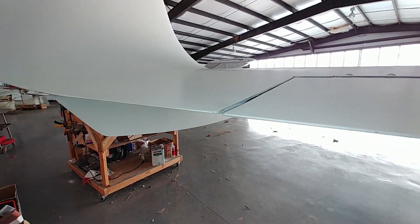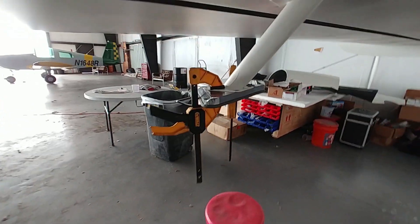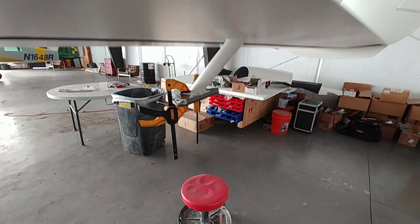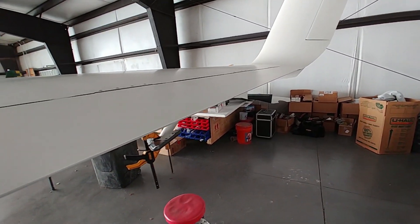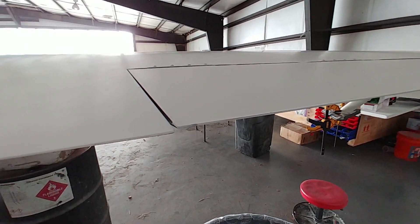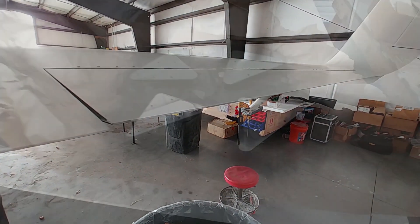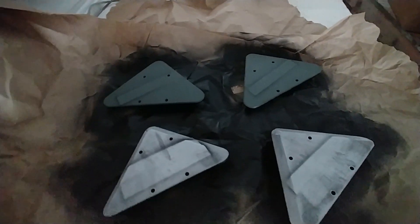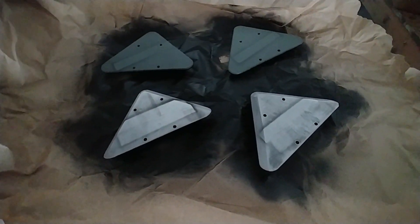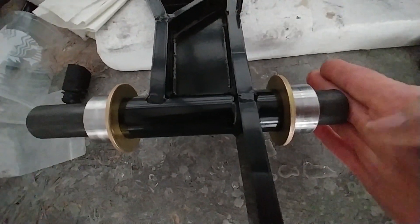This one needed a little bit more because of the trim tab, but I kept both of them at the same weight. So ultimately the other one ends up hanging a little bit higher because of that extra weight, but overall those controls are connected anyway so that will all even out once they're reconnected. Given that those extra weights were straight-up lead, I figured it was as good a time as any to paint them — just rattle-canned those — and the other ones had primer on there so I decided to paint those at the same time so everything would be better protected and look the same.